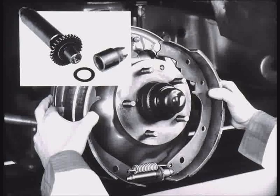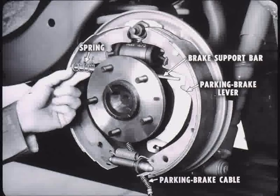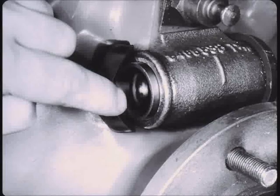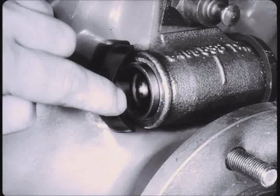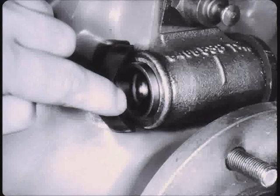On a rear wheel, unhook the parking brake cable and remove the parking brake strut and spring. Remove the parking brake lever from the secondary brake shoe by forcing off the c-clip retaining the pivot pin. Carefully pull the lower edge of the boot out of its groove and check the interior for signs of excess fluid. A small amount is almost always present and acts as a lubricant for the piston, but large quantities indicate the cylinder needs overhaul.